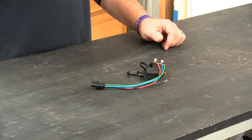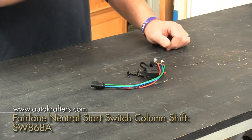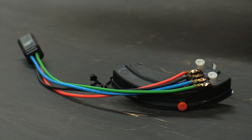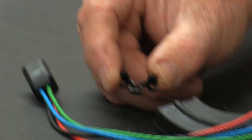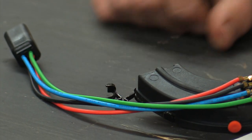It's not where you might think. A lot of transmissions will have a neutral safety switch on them. On the Fairlanes, they didn't do that because the tunnel size was a little too small. They actually put it on the column. This is the new part — these have only been available as new old stock items for quite a while. It comes complete with everything you need: the original Ford Motorcraft instructions, the neutral safety switch, and the clip pin, which can sometimes be missing.